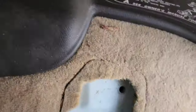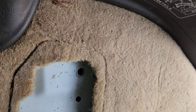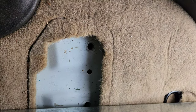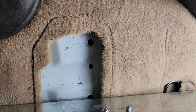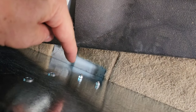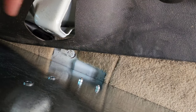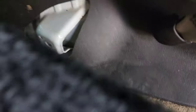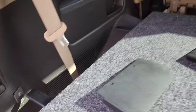Word to the wise: on this side you're going to be using the outer bolt, the inner hole, and that other hole tucked underneath. You might want to tape or plug those holes - you can see the bottom of the vehicle at the right angle. Those are holes in the tub of the vehicle that go right through. You're bolting to one of them, so tape over the other two. Same thing on the other side. If you're doing deep river crossings you definitely want to seal those with duct tape.